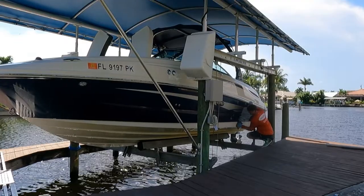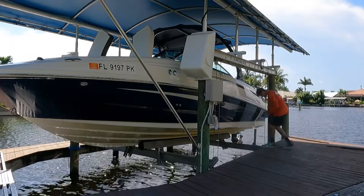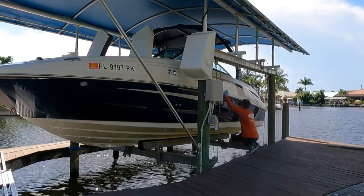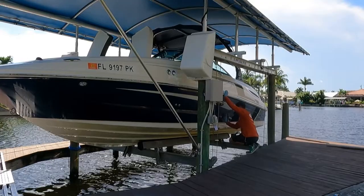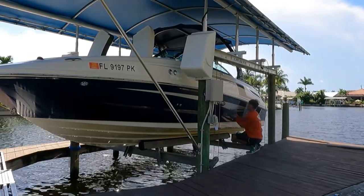I'm just doing the first wipe now. So you wanna do two wipe offs. So you're gonna have an initial microfiber plush and you're gonna have a second microfiber plush. You're gonna come by, take everything off with one towel, make sure you get it really good. And then the second one is like your finishing towel. In case you happen to miss something, you're gonna come back and give it that final wipe, because we don't wanna miss any polymer on the boat.